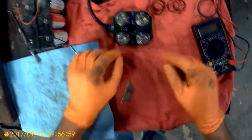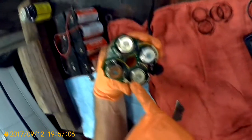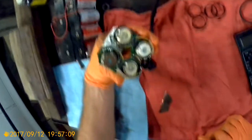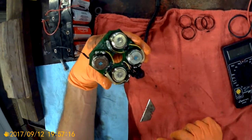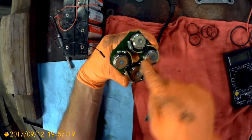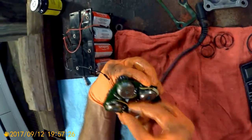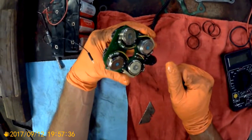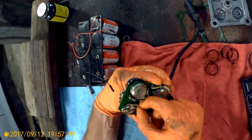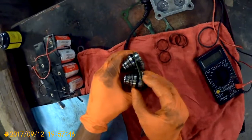Take a look at the other side of the board and notice if there are any cracks. These four resistors should be on there — this is a new board from Dr. Vanos so it looks a little different, but if one of those four resistors is missing you'll need to send your board out or get a soldering iron. Also look at where the wiring goes from the board to the solenoid itself to check for any breaks. You can see here there's a slight break on the black wire — and just because it's black, it is not ground; that is actually a power wire. We're going to use liquid electrical tape to get that back up and running.